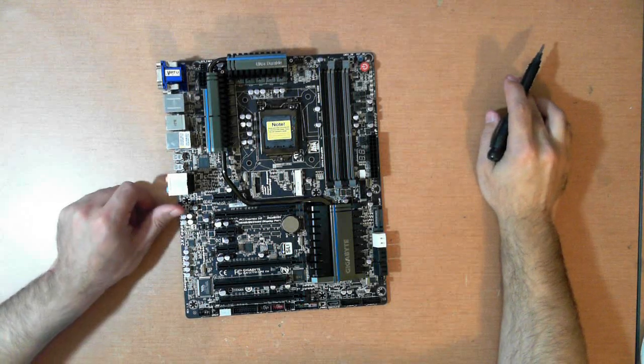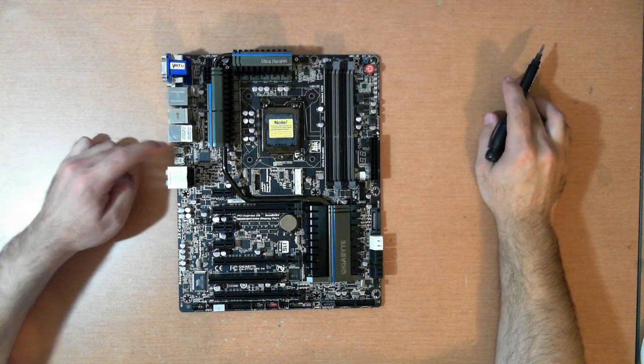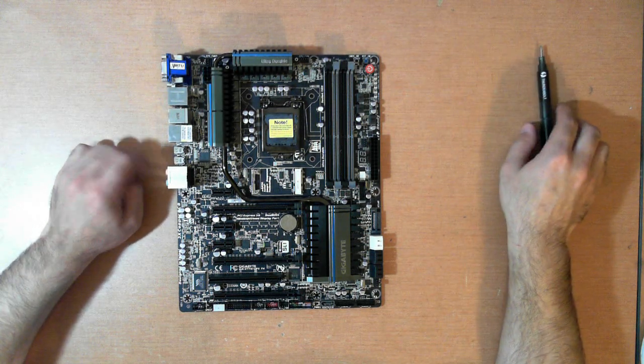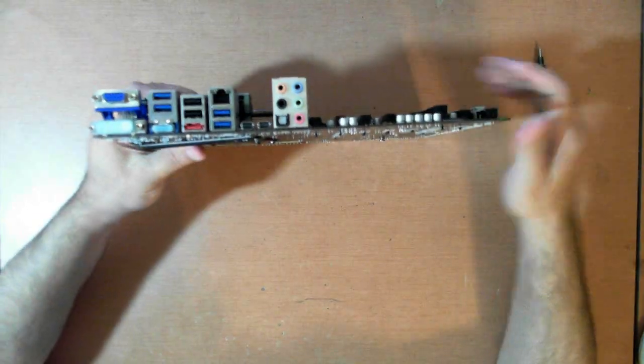Then you have a Thunderbolt controller here. That's another big feature people have been wondering about. This is dual 10 gigabits per second. Basically that means that each of these ports can supply 10 gigabits per second. It uses up a lot of PCIe lanes, and I'll describe to you how they do that later.